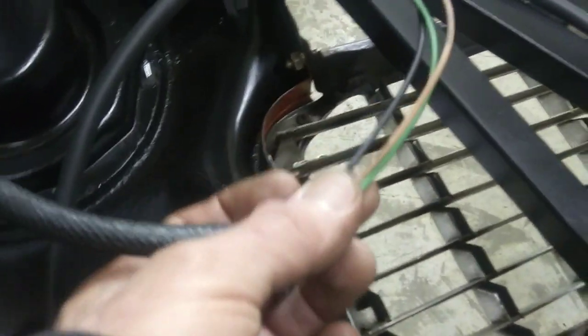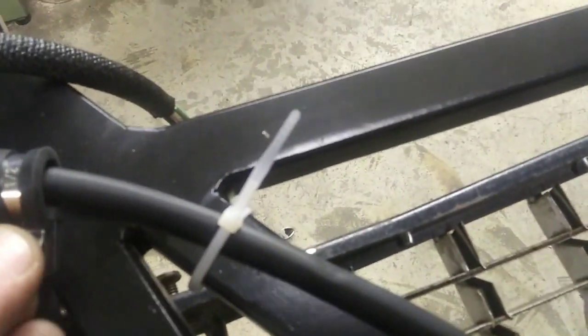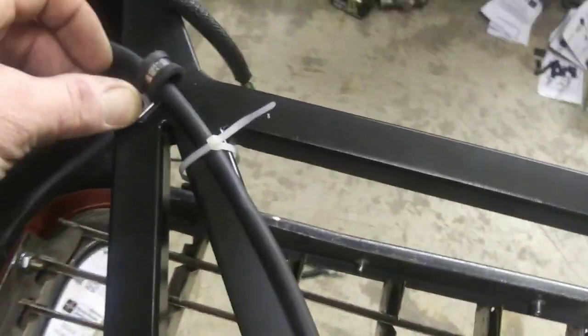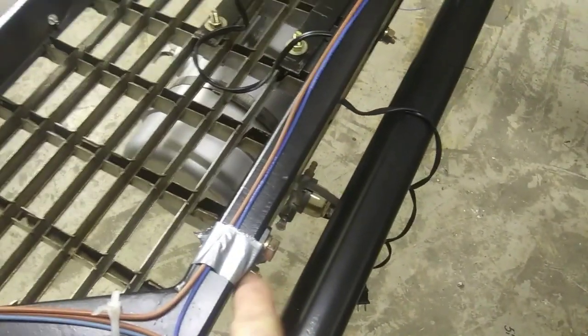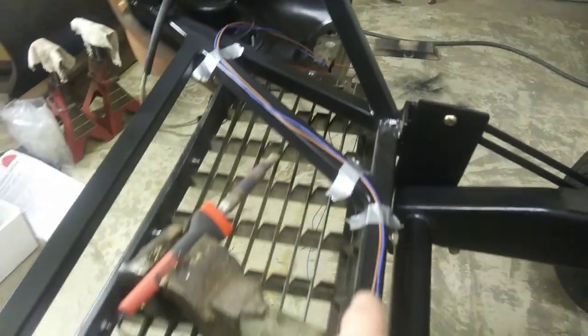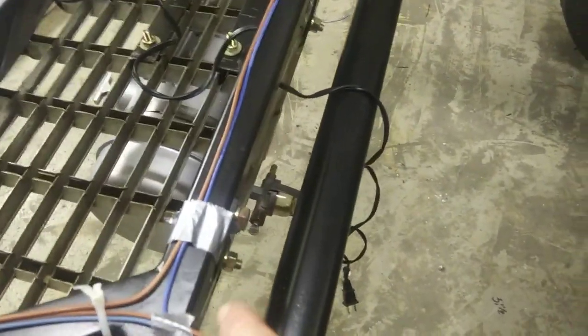Same with the headlight - hook the green headlight wires, high beam and low beam, then jump off high beam and low beam and go over to the other side. We're gonna fasten it with these little clamps, get it all taped up. These are half-inch but they might work. I'll run them on the inside, maybe on the bottom. We'll see how close this is to the radiator when I shut it. The parking light and headlight wires will run on that same channel, so I might loop this around and run it across the bottom of the tilt front end structure with nice little oval clamps.